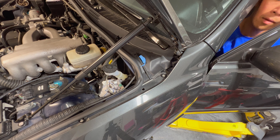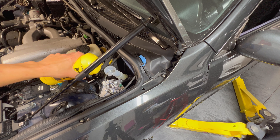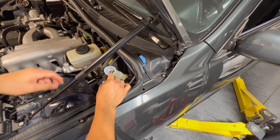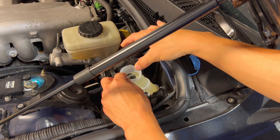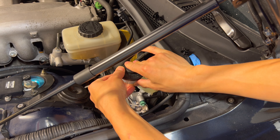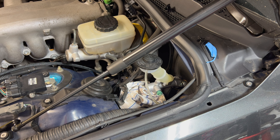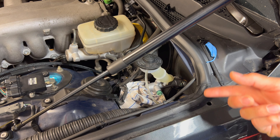I can see the fluid coming through now. Now that some of the fluid is into the actual master cylinder, I'm going to top it off so I don't get any more air into here. Every time I pump it now with the fluid in there, it pumps pretty strongly. I just need to make sure I clip this down so it holds but still has enough room to recirculate the fluid. The whole line is full of fluid with no air in it. Go ahead and disconnect this.